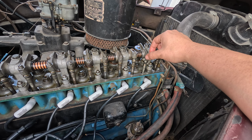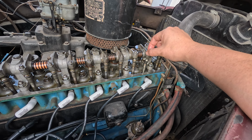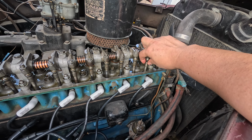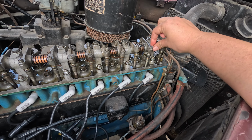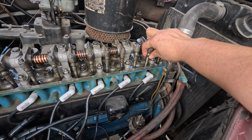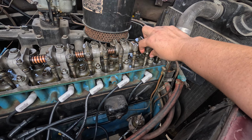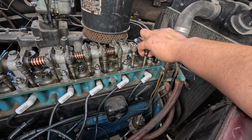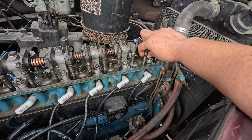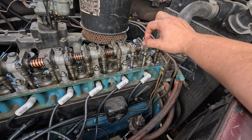I'm hoping I can maybe just replace the cam, but yeah, the cam lobe is completely worn out, and whoever owned this prior to the previous owner, the guy he bought it from, only had it for a few months, and I trust him, but I think whoever sold it to him either knew or didn't know. But it looks like it's been welded and then ground, so somebody knew. We tried to do a repair, and yeah, it's unfortunate.